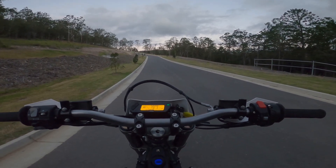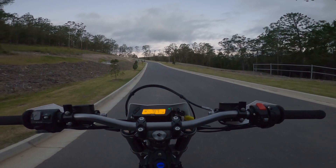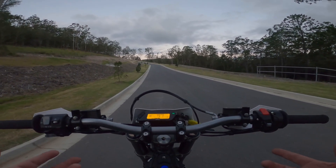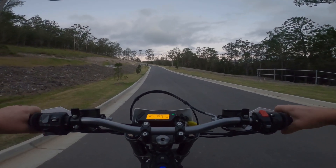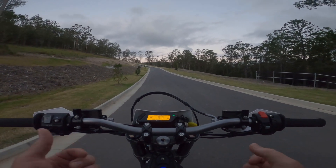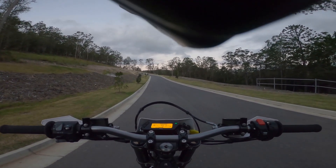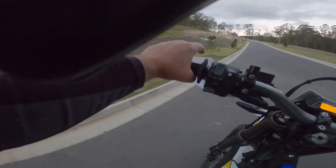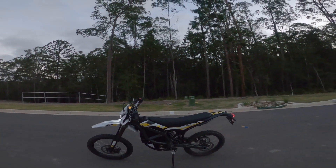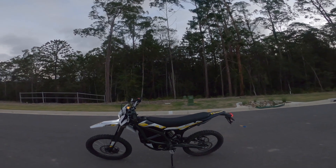So I think that's a good test. On level five we hit 33–34 km/h. Without regen we got up to 49–50 km/h — big difference. In the bush, what the difference makes is you go further with regen on, plus you get less forearm pump because you're not always relying on squeezing your brakes to slow down. Personally I'd prefer more regen than this bike's giving me, but at least it's got some. In the last event I had it on a low or no setting and it was terrible — I hated it. That was my major criticism of the Ultra-B, but I'd have to say now it's definitely one of my favourite bikes. After seeing it keep up with the competition two-stroke bikes, this bike is going to be really good. I'm looking for a few more faults, and definitely the wheels we've got to change, but everything else has been holding up pretty well.